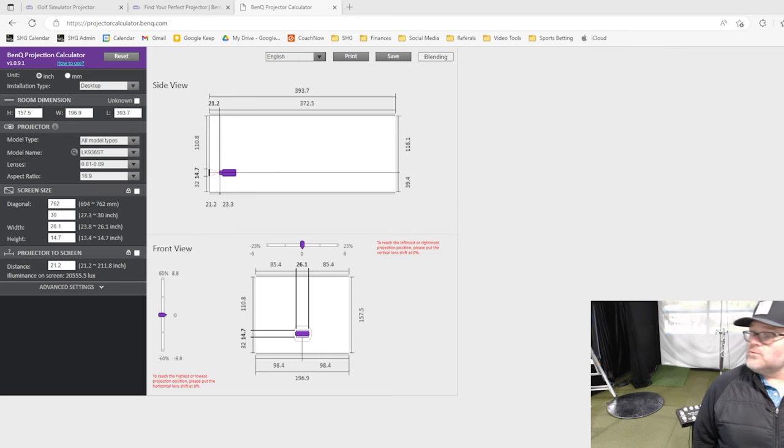Here's my picture from Harbor Shores — you can see the greens and blues. Now let's talk about how to set this up. The first thing you have to figure out is how far away you want the projector. When setting up your projector, the easiest approach is to get the vertical filled — top and bottom — first. It's easy to bring things in from the sides but harder to go vertical. I measured the height of my screen: 91 inches.